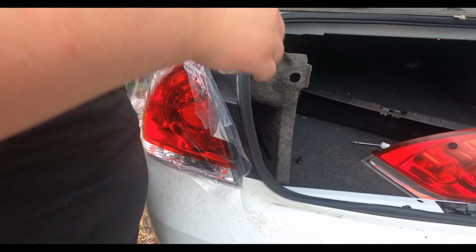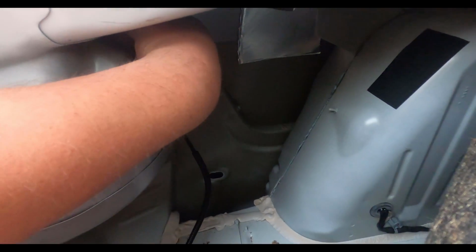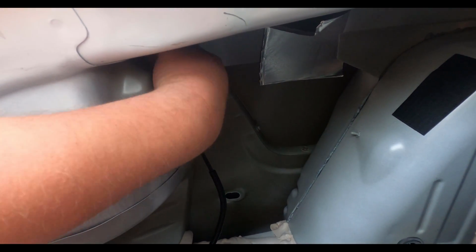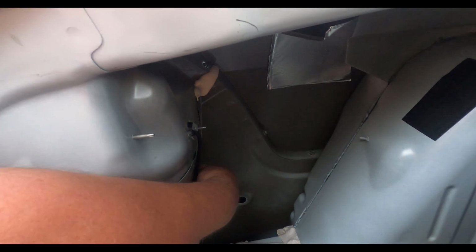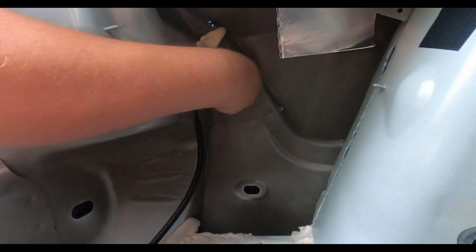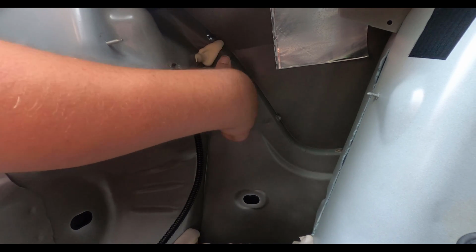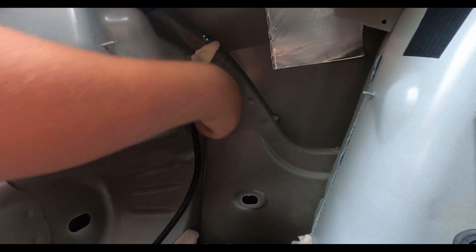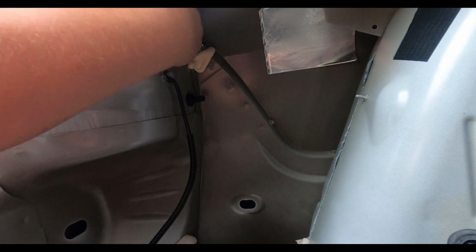All right. Then you just want to screw your little, what are they called? Finger nuts? I don't know. And I'm not cranking on them. There it is. I'm not cranking on them yet because I kind of want to suck them in together. You don't want your taillight getting cockeyed in there, and then next thing you know, brand new taillight's cracked. So just work them in.